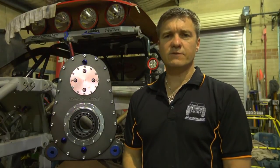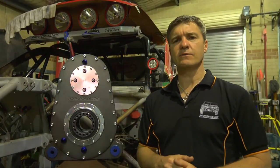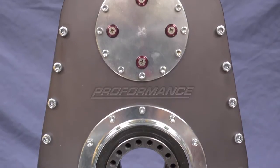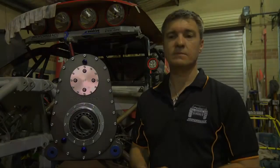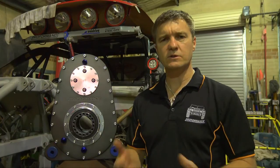In a four-wheel drive vehicle, changing the final drive ratio requires both the front and the rear diff to be re-ratioed with the new ring and pinion combination. Changing the diff gear sets is a pretty time-consuming job — typically eight or more hours to strip the differential, clean it, put the new ring and pinion in, set up the backlash, set up the gear mesh and set up the bearing preloads. It's not something you want to do on a regular basis. With our quick change gearbox, you can actually change the gears very quickly by removing the front cover, sliding the gears out and changing the final drive ratio in a matter of minutes. We typically recommend customers have a few different sets of gears to allow different top speeds depending on the track you're driving on.